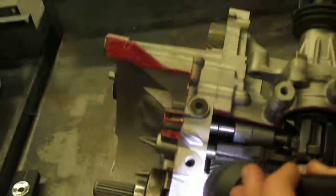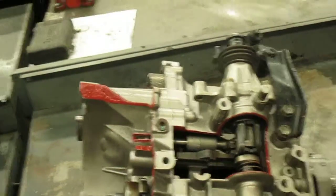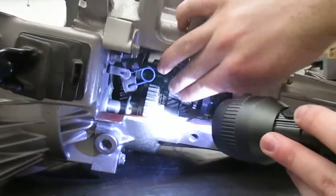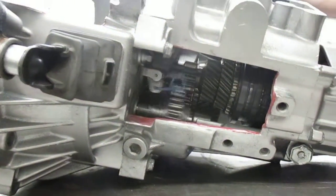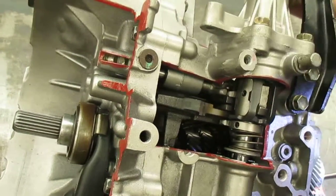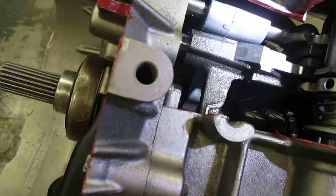You can see a slight bit of yellow — there we go, that's a good view of that gear with the yellow paint dot on there. That's the final drive ratio gear, and that connects over here to the differential ring gear. If we shift into reverse, you can see it moves this back fork, and right here is a reverse idler — this is the actual gear that slides over on the shaft. Coming back up, we can shift into first gear. Selecting first, the flow of power goes in through here, then into these two gears right here, and then out to the final drive.